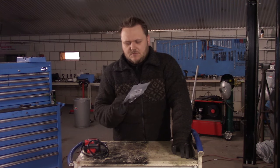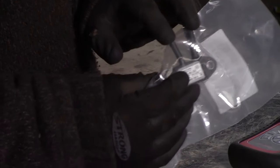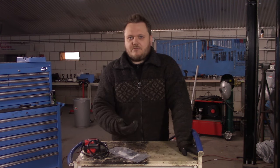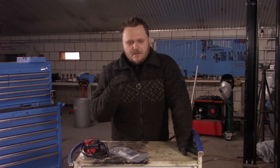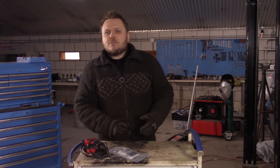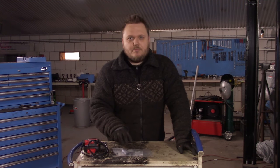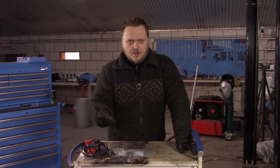It can be faulty, but it doesn't have to be the sensor that is the fault here. The two hoses that are connected to it can just deteriorate and break. But I looked at them and I could not find any breaks or leaks within those hoses. Then again, it is really a nasty place. You cannot see it, so I had to use mirrors and lights. What I could see, those weren't broken. I didn't get the hoses. It's really stupid of me, I really should have. But my parts supplier didn't have those, so you probably need to get them from the local Renault dealer.